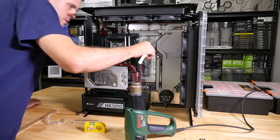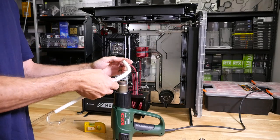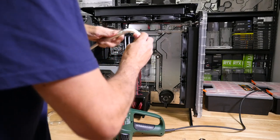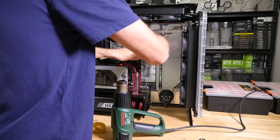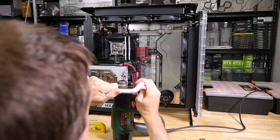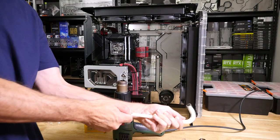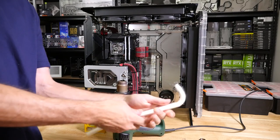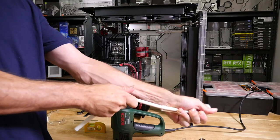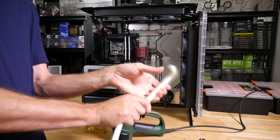For offsets, similar kind of thing. I'm going to do this tube here now, which has a 90-degree bend and also an offset of roughly 30mm down to this fitting. The first thing I'm going to do is figure out roughly where the bend needs to go, leaving about 20mm of overhang so I can cut that off later. Because I'm putting an offset in this tube, I've heated it until there's no resistance — the only resistance coming from this bend is from the silicone itself. Now I need to move quickly because it's going to cool down really fast. Something to watch out for when you're pulling the silicone out is not to grip your thumb onto it, because it extends the silicone and when it snaps back it actually peels off your thumbnail a little bit — it really hurts. So just keep your thumb up out of the way.